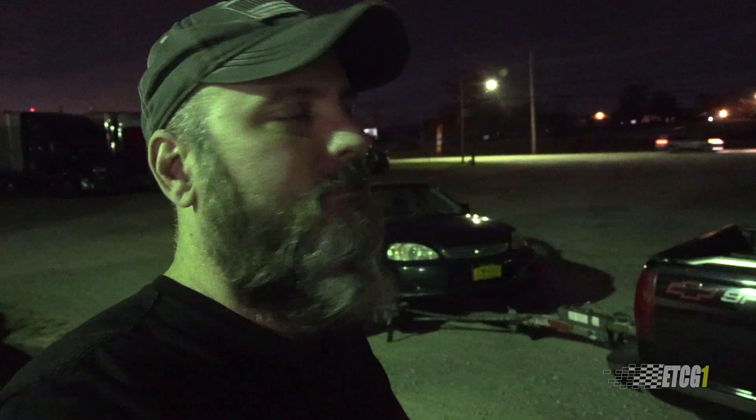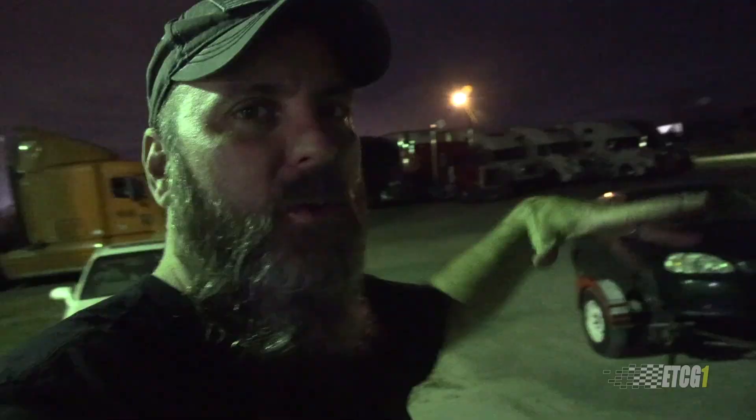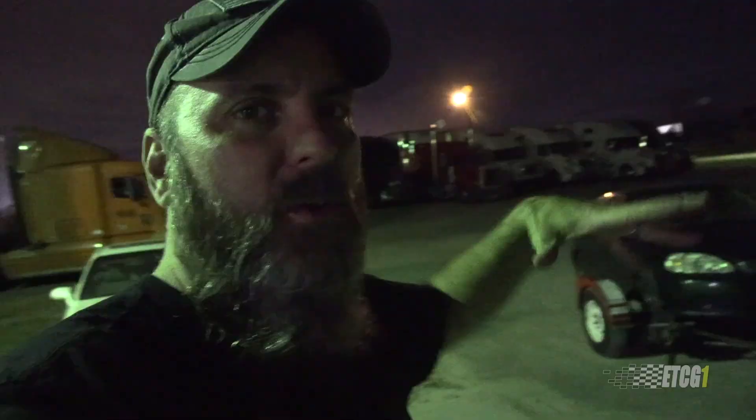Ran great. Small oil leak — I'm not sure what that is, I'm going to have to suss that out. I've been on the road for almost 14 hours now, a little tired. One last thing about car dollies as opposed to car trailers: it's almost impossible to back them up. They crumple up like a piece of paper because where the front of the car sits on the trailer articulates, and your wheels can turn a little bit too, making it all weird — virtually impossible to put into reverse. To try to keep the steering wheel from moving around, I put the steering wheel holder underneath the steering wheel on the car being towed. It was virtually useless. Your best bet is to try to lock it into position in some way.